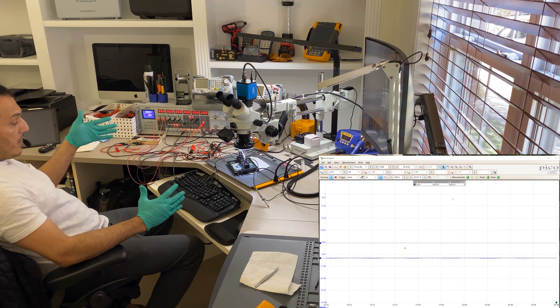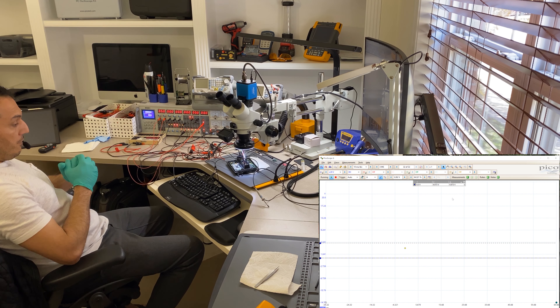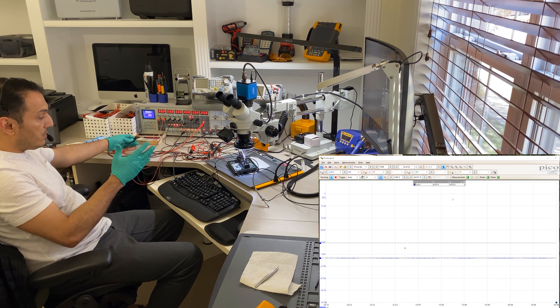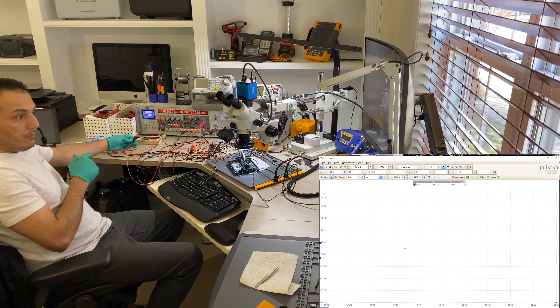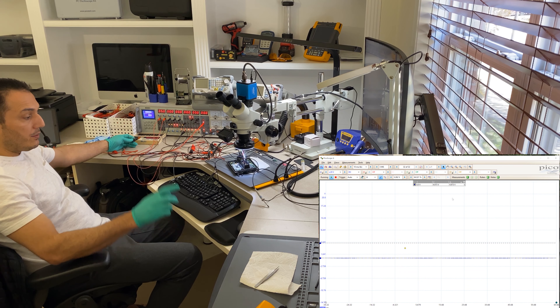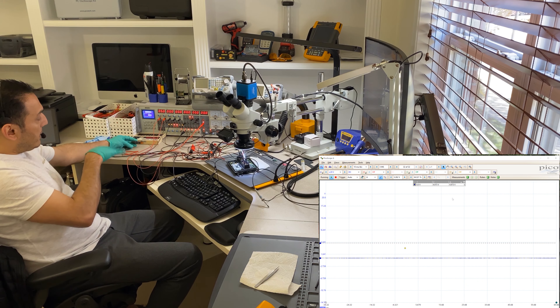This should run perfectly on the engine — this is a good fix. I like to also use a test light as a load to verify the fuel injector activation. And since the driver is inside the coil itself, the signal coming from the computer to the coils is a zero-to-five-volt square wave timing signal. The computer handles ignition timing based on the cam and crank inputs — but that's it, the repair is complete.